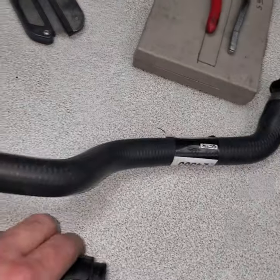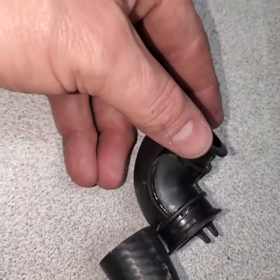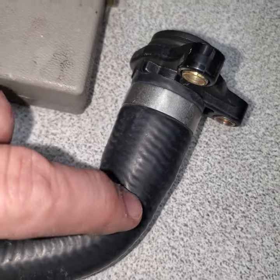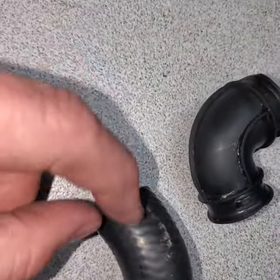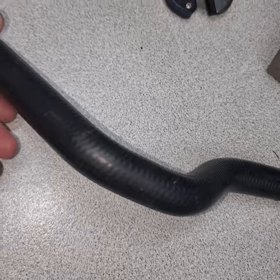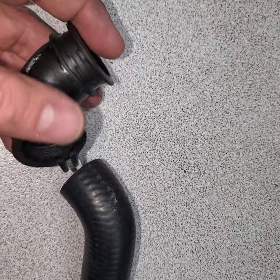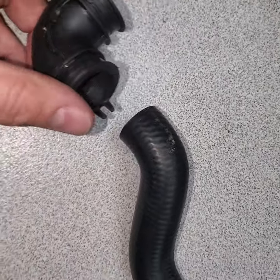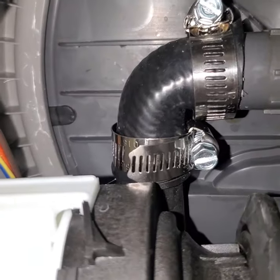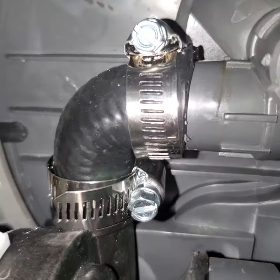All I was looking for is it had a 90-degree piece on here, and that 90-degree piece looked exactly like this because it had a flared end to go over a hose just like this. This side was 90 degrees. So go to your auto parts store, find these heater hoses, ask them to go behind the counter, and just find one that has a 90 on it, flared on one end and the right size on the other. I just literally cut it off the end of that formed and fitted hose because you'll never get a bend this tight, and that's the finished result.